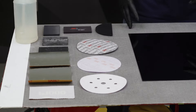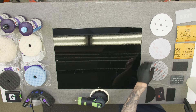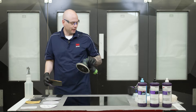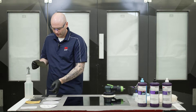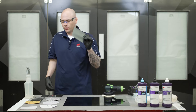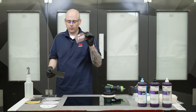Let's look at paper first. When it comes to papers there's a lot of different options out there and a lot of people can get lost in all the variety. There's going to be sandpaper that's used with blocks and then there's sandpaper that's used with DAs. First let's cover the sandpaper that's typically used with blocks. With blocking paper there's a few different options — there's a wet or dry type paper which is really common, and then there's a less common paper known as a flexible abrasive.